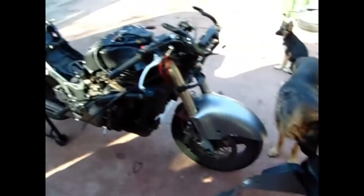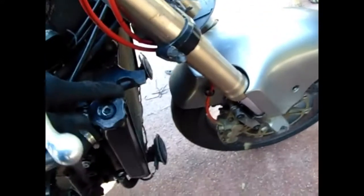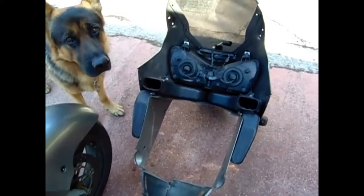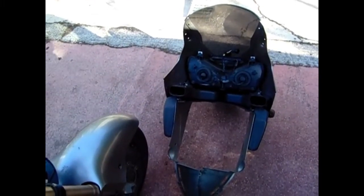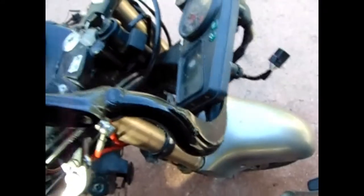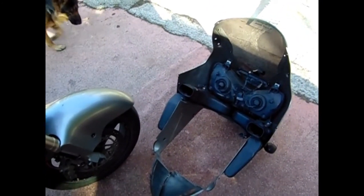I've got the front off now so it's looking a bit barer. It turns out it was the mirrors holding it on - a little bracket there and same on the other side - which is unbelievable. All I had to do was unplug the headlight. That wire I thought was the ignition switch actually comes up here and goes into the clocks, so there was no need to undo those two bolts on the bracket. I'll put that to one side and carry on.